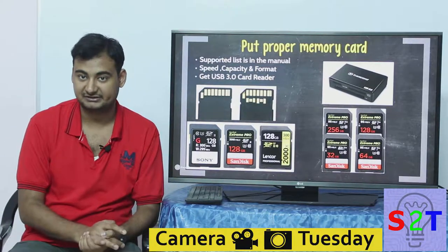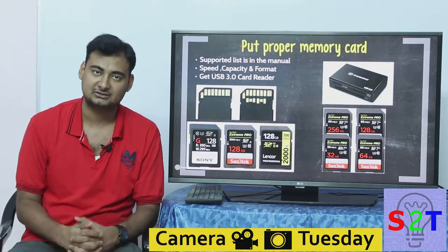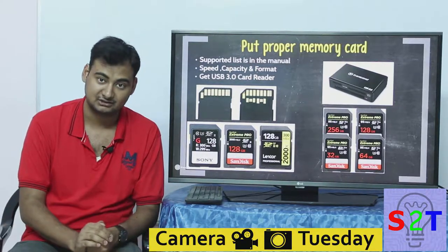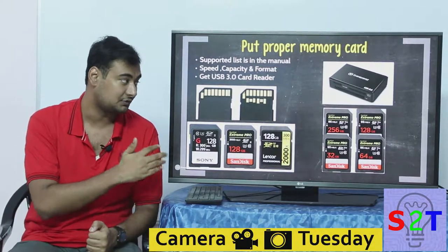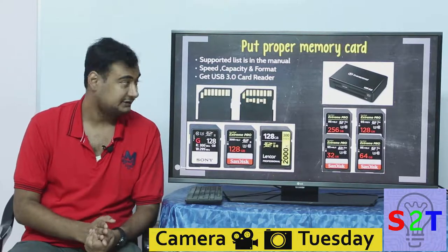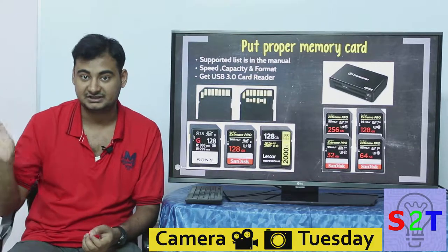Many photographers still buy UHS-II cards even if their camera only supports UHS-I, for a simple reason: if you have a 128 GB card, you want to dump that information to your computer very quickly. This is why I'm specifying — please get a USB 3.0 card reader. Even when shooting full HD video at 60 frames per second, file sizes easily go to four or five gigabytes. You don't want to sit around just waiting for file transfers, so please get a USB 3.0 card reader.